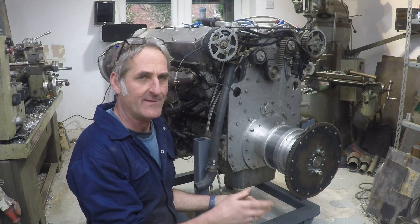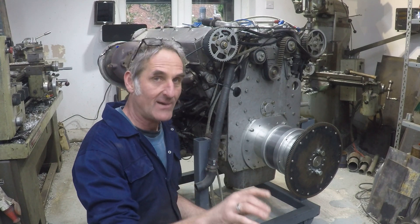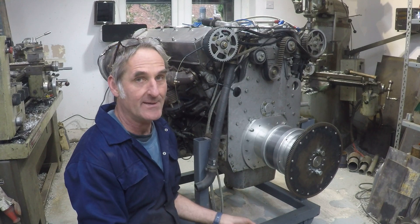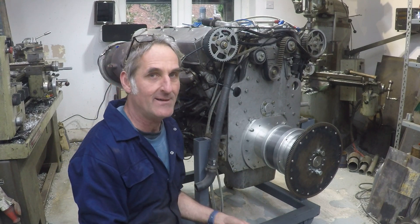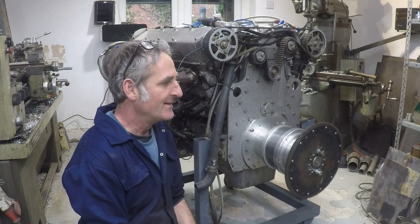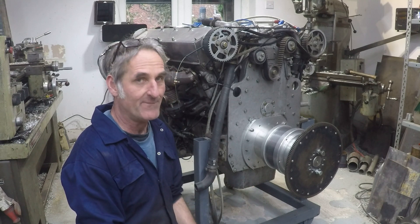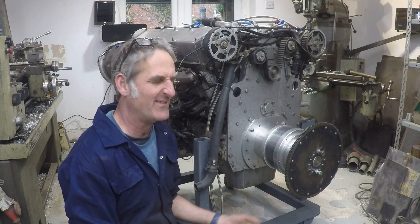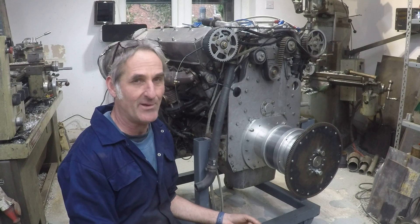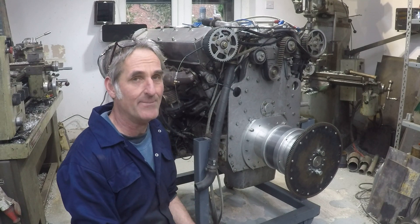This General Motors TH400 transmission we're using is straight through, so basically you get engine speed straight to the rear axle through the crown wheel pinion ratio, which is 3 to 1 in this case. When you do the maths it gives you a top speed in top gear of about 95 miles an hour. This Land Rover had a top speed of something like 60 when it was new, so that's a decent percentage increase — until you think of how big the engine is. This engine would pull that vehicle along at 95 miles an hour doing about 750 rpm, so with those gear ratios, cruising on the motorway the engine is going to be doing 2500 rpm or more, which is really high up in its range.